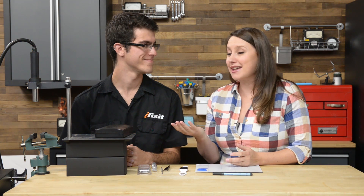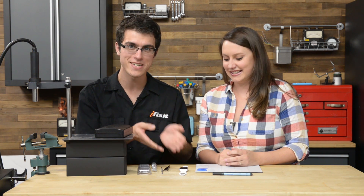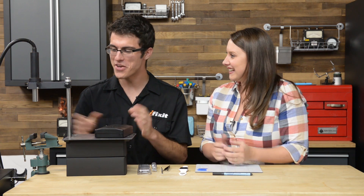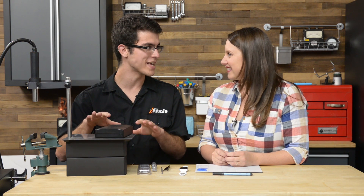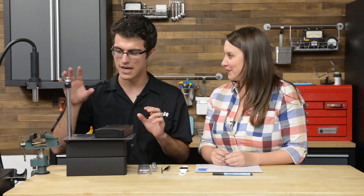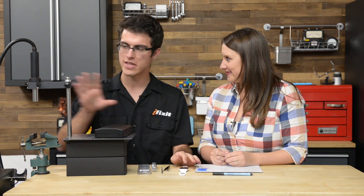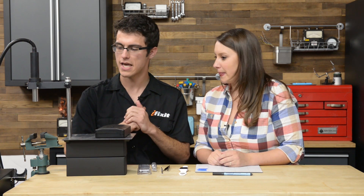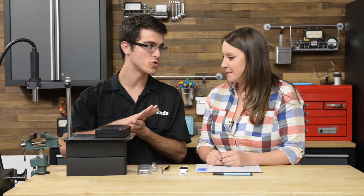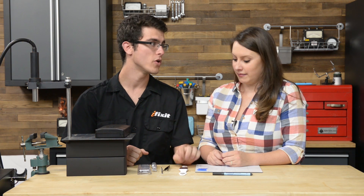Hey guys, I'm Gwendolyn with iFixit and I'm here with Alex, our in-house expert for Apple Watches who didn't get to go to Japan. I get to do my own teardown here, so I'm very excited to be doing a video. So this is my station for removing displays from the Apple Watch — I've done about 100 to 120 Apple Watches for the Series 1. I'm using a reflow station, usually used for laptop motherboards and logic boards, as a heat-controlled heat gun so I can melt the adhesive without damaging the LCD.